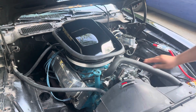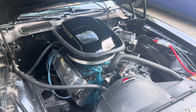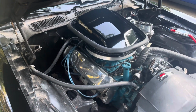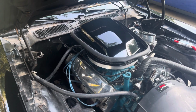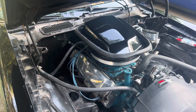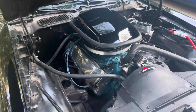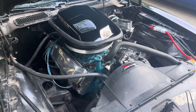And I still ended up modifying the shaker mount and everything. Plus, I took the AC box out, because the right side valve cover was damn near crammed up against the AC box, and that was a concern. Every time the motor would rock, it was hitting the box. So I took that out of there, because I wanted to upgrade the air anyway. I am going to upgrade the AC on it, put the vintage air in it and stuff.